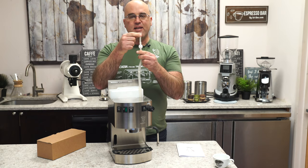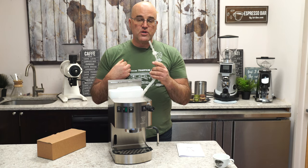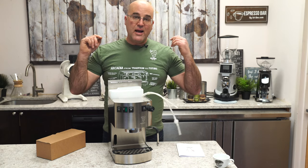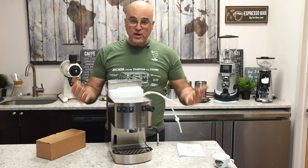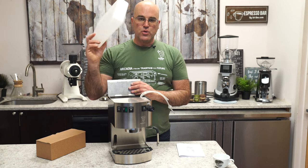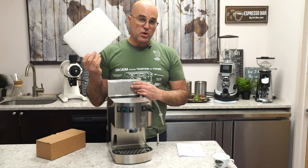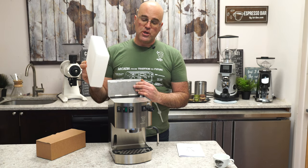The machine has a satin finish cord that's not detachable in the back. The reservoir lid is not removable. You'll see a particle filter in here. There's an extended hose for a detachable water softener — our code is V725. Get it for this machine; it will reduce your problems by over 90%. Most problems in these machines are caused by lime scale from your water.